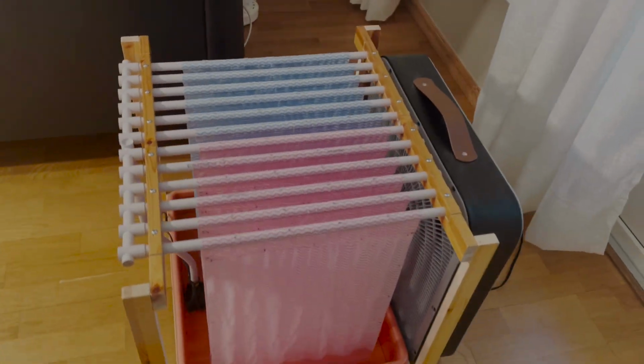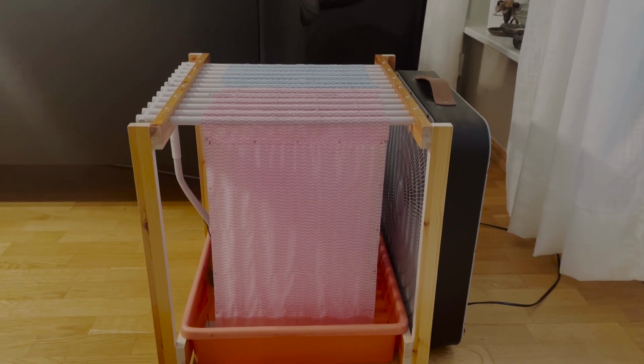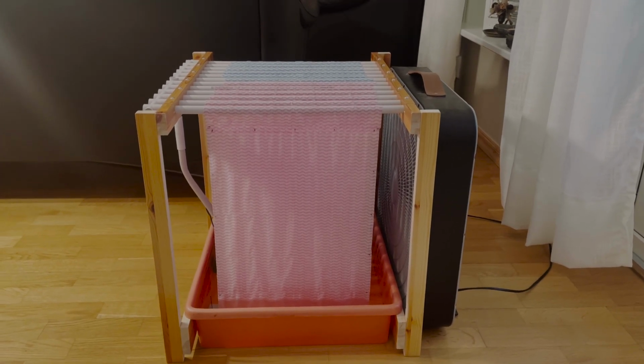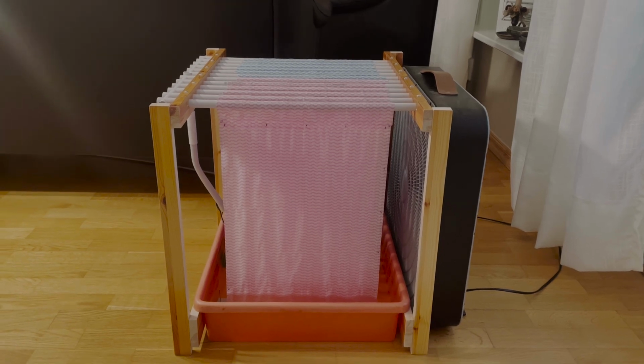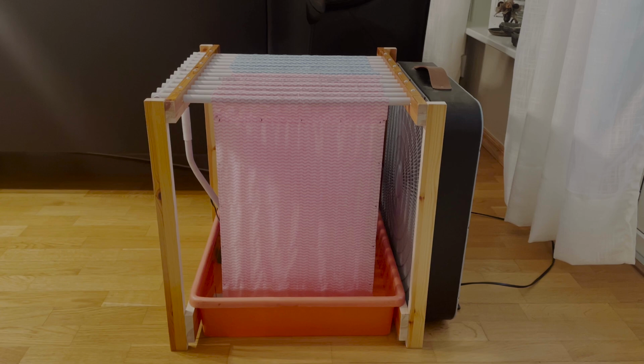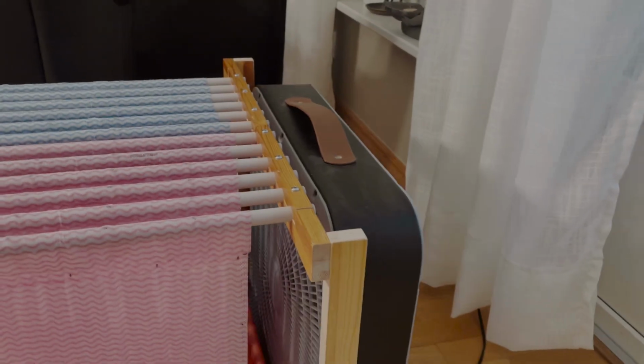A simple construction with an aquarium water pump, that pumps up water and moistens hanging dishcloths. A fan creates an airflow past the cloths, and the water evaporates. The humidifier converts 12 to 15 liters of water per day into water vapor.